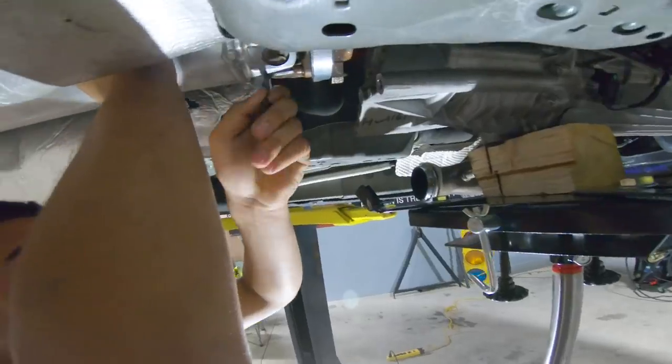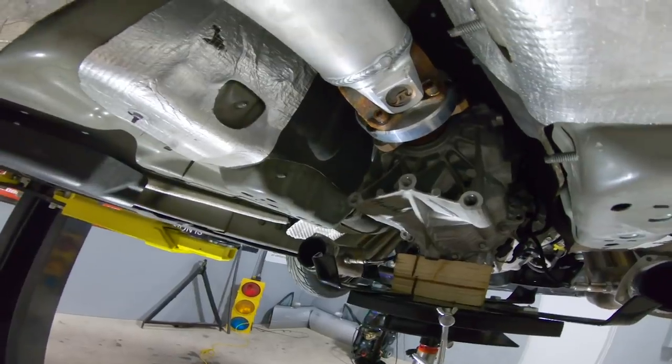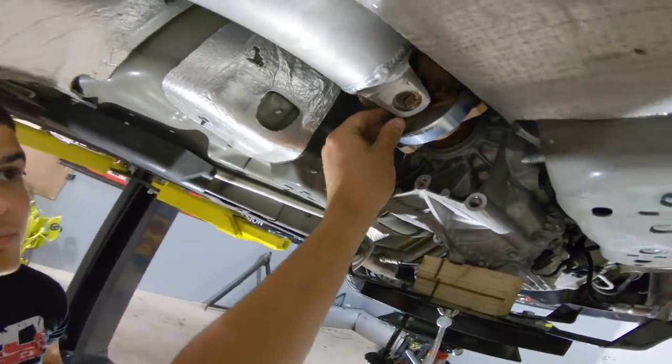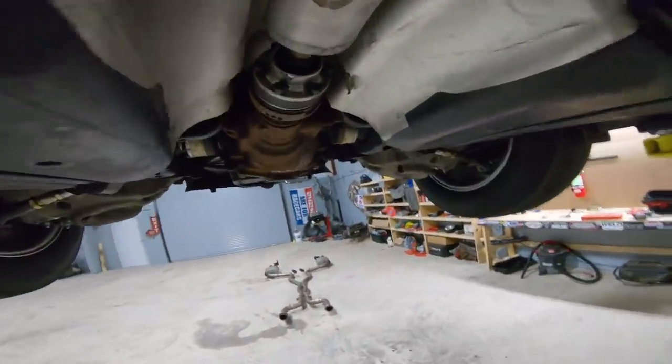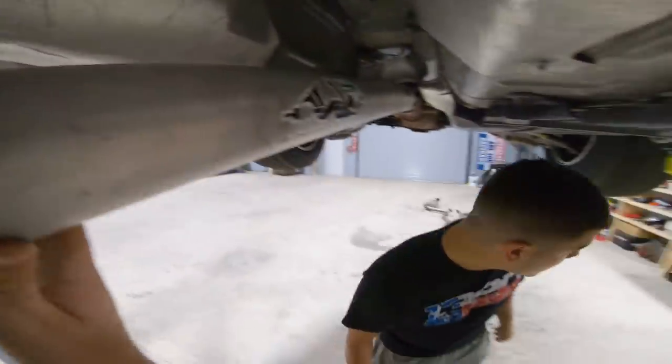Nope. All the drive shaft bolts that hold the shaft itself, there's a joint right here, and every single bolt was literally just barely hand tight. That is not good. We should probably check all of them in that case while we're under here. Oh yeah, look at that, dude. You can easily get to the shifter now. Everything is so easy with a lift.